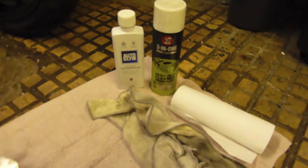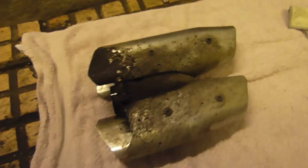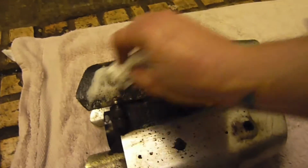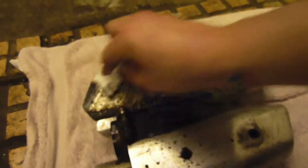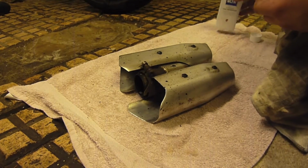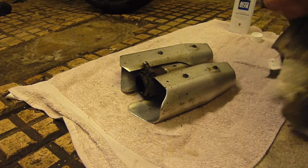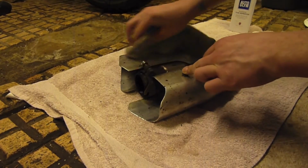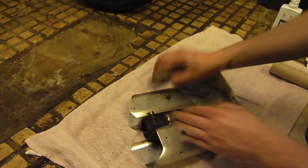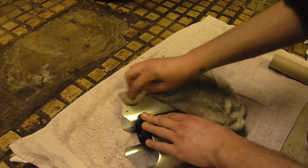For certain parts of the bike, it will be beneficial to remove them so as to clean them thoroughly. Remember, you only need to do this once every 12 months, so it's certainly worth the extra effort. I removed the exhaust end can to get the tar and dirt off. I used a heavy-duty degreaser first to remove the burnt-on mud. Rub it back with a dirty rag and get it as clean as possible before using some tar remover. This clearly shows how great this stuff is. The tar on the exhaust comes off with ease.